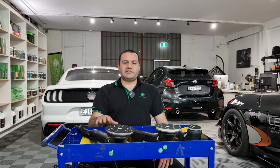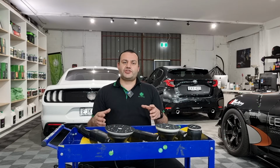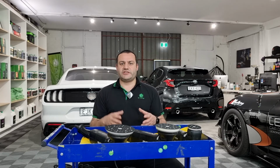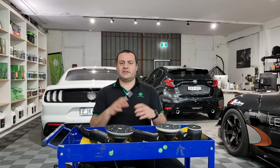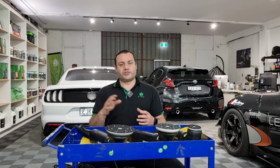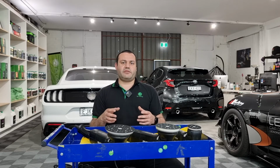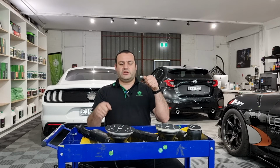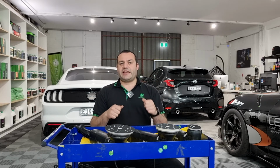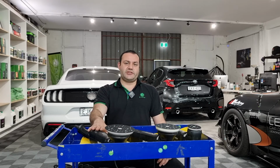The next thing is, being a bigger pad and a bigger throw, it is also harder to use. Once you start getting to curvatures and concave and convex doors and all kinds of bubbly shapes with modern cars, you do need to be more skilled when you use the 21, because you're going to get pad stall quickly, and you're probably going to find that as you angle the machine in a specific way to keep it spinning, you might end up wearing out your pads faster. So these are the pros and cons of this machine.